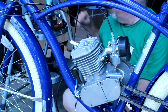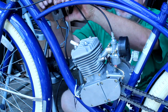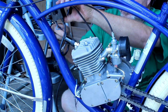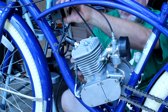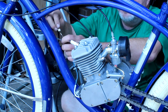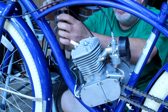Now we are ready to mount the CDI. We're going to mount it here on the support tube, which will allow it to reach the spark plug. We have the wires here — a blue wire and a black wire — and then you have the wires coming from the motor. You want to match the same color wires together. Go ahead and mount the blue to the blue and the black to the black, then push your insulators over it.